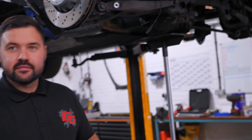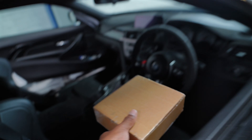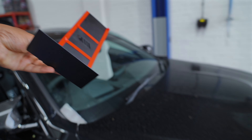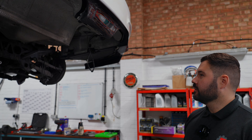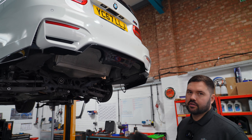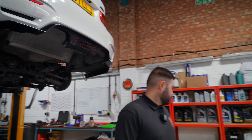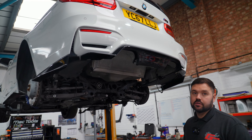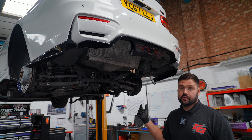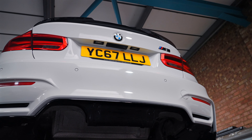Not bad, not bad. What are we up to? Tommy's extremely busy, so I'm going to be fitting these mods myself. The first one goes in the interior and the second one goes in the engine bay. So let's drop that off and see what else Tommy's been up to. On this one we've had it in recently for servo motor repair - you know, the old clicky clicky. And then it came back, had a crank hub, mid-pipe. And we also know if somebody's doing that, it had a really bad differential leak on the input seal. So it's having a new seal and the double bush mount conversion - of course, the best way.